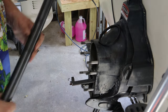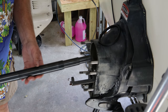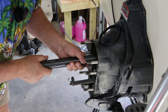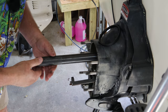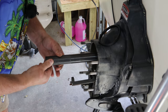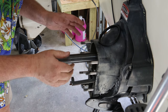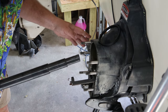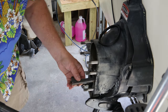Now that we have the motor mount back in place and sitting down under its weight, we're going to double-check the fit with the alignment tool. This is lining up several diameters to make sure they're all in line with one another, so when you reinstall the outdrive it all goes back together smoothly with no binding and no extra wear. I've got it in all the diameters — I felt it bottom out right there. It moves freely, just a tiny bit of play — nothing's in a bind. Perfect, that's what we want.